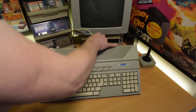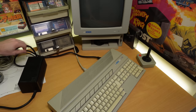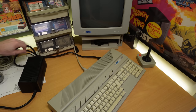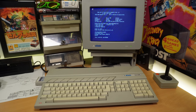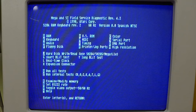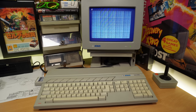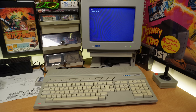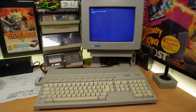The 260ST was certainly the kind of early machine that this setup was designed for. If you want to know more about the story behind the 260ST I made a video all about it, linked in the usual places. One of the reasons these early machines were so compact compared to my STE were the external power supply and floppy drive, so let's get that PSU hooked up. On first boot it runs through the same tests as the STE, and we can see that the errors are gone. One interesting thing is that it's running the very early bootstrap software that predates TOS, and the cartridge actually detects this as a Spanish OS version 0.0. The video timing in these very early machines is a little bit ropey, and I couldn't get my camera to lock onto the slightly out of spec refresh rate, so sorry about the slight flicker. Most of the tests aren't very exciting to look at, and for some reason the audio test doesn't output any audio on either this machine or my STE, which is a bit odd.